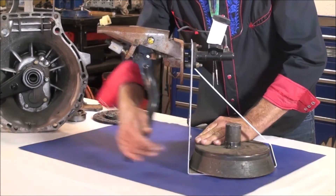The clutch will not disengage even though the pedal feel is normal. To diagnose the problem, hammer the clutch pedal, hold it down, and try to put it in first gear. Repeat that several times until you can get it into first gear. Once you get it into first gear, you'll know that it must be a broken clutch disc. The next time you go to shift the car, it will be stuck and locked up again.